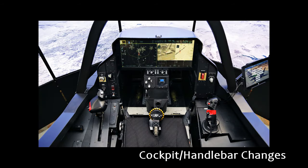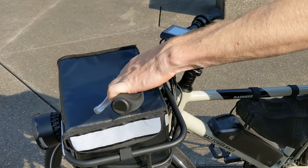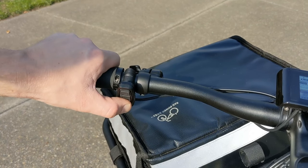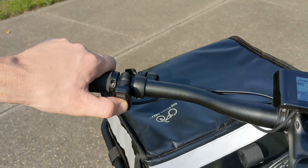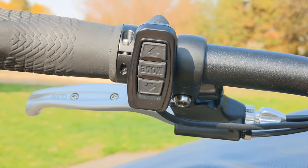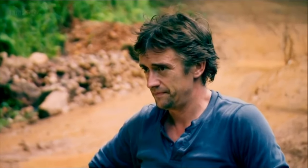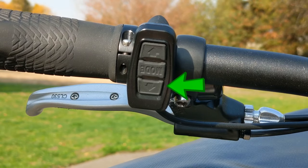Finally, the changes to my cockpit. I installed a set of generic mountain bike bars that I bought on Amazon and a set of lock-on ergonomic grips. I also recently decided to reposition my pedal assist controller to a more comfortable position, flipping it upside down and on the bottom of the bar, similar to how you would mount a shifter. This lets you press the buttons more easily without moving your thumb to the top of the handlebar, and I definitely prefer it. I also wanted the more-power button to be in the most comfortable position for me on the bottom.